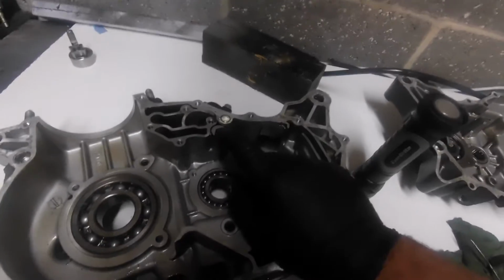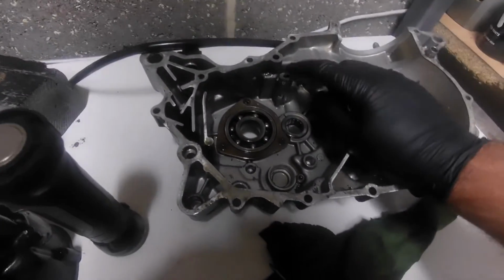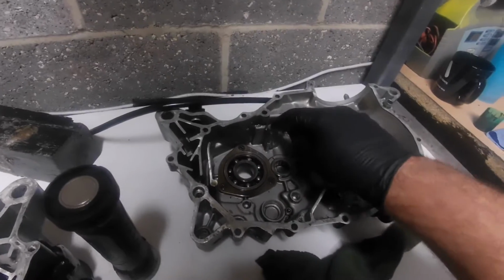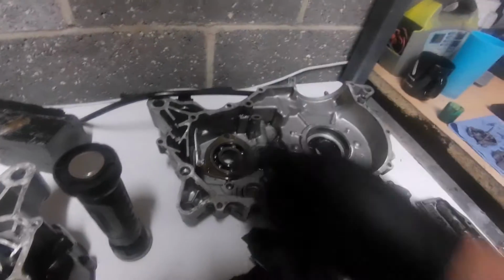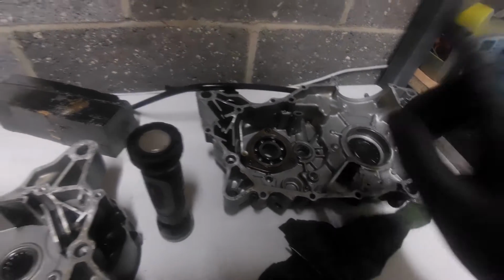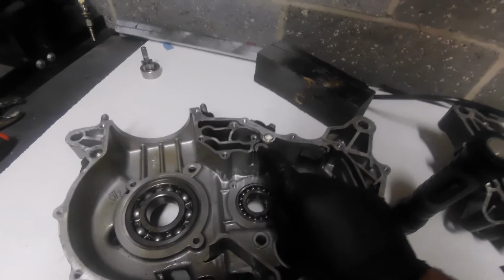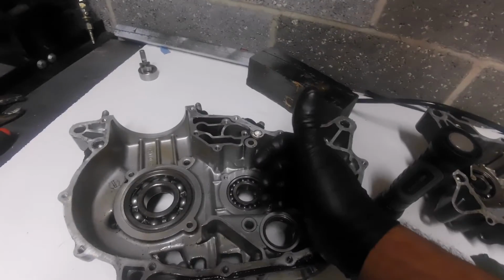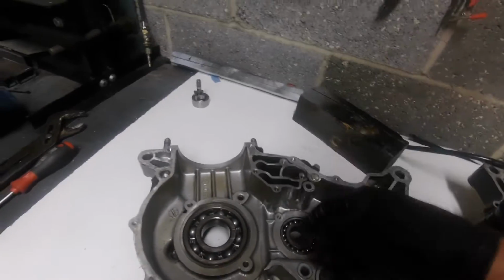Well, I'm going to stick my neck out. Personally I would have thought, okay, I get the idea that the scavenge pump could be sending too much oil to the oil pressure pump if we didn't remove some somewhere. Imagine these jets coming out like a hose pipe because there's that much pressure in there going to the pump. But I would have thought perhaps not quite so big an orifice, maybe a restrictor in there, like a grub screw set in there with a hole down the centre, that could bleed off some pressure, but it would predominantly send the scavenge side of the pump.